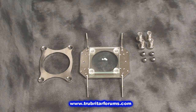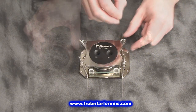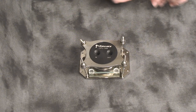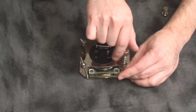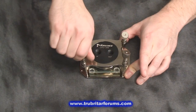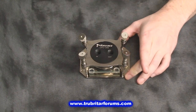First we're going to install our water block on the piece of glass just as we would if it was a real CPU. Next we're going to install our top tension plate and pivot balls. And finally your tension spring and tension nut. Tension all your tension nuts equally and evenly. Make sure they're firm, but do not under any circumstances over tighten these, otherwise you could potentially damage your CPU water block or your CPU itself.